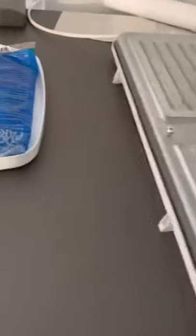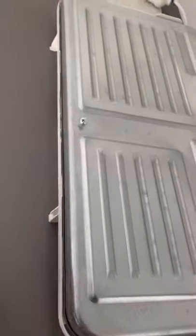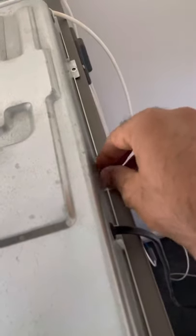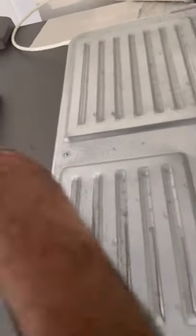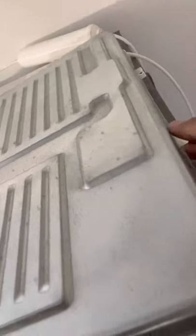So when you go to the top of the fridge freezer, up here you've got a panel. I'm going to try and hold this as best as I possibly can. So you've got this square panel up here - it's got three screws, so you'll need a cross-head screwdriver. Unscrew this one and then over here it's got another two. Simple - open these three screws and then this just lifts off.